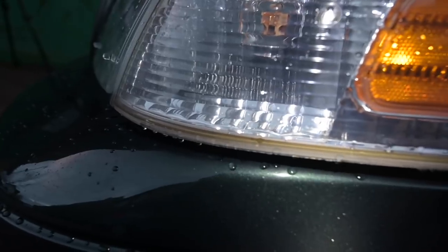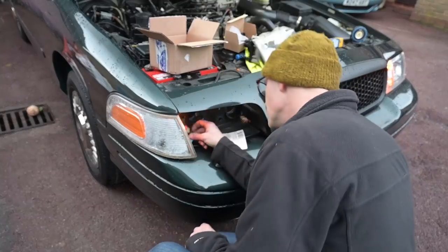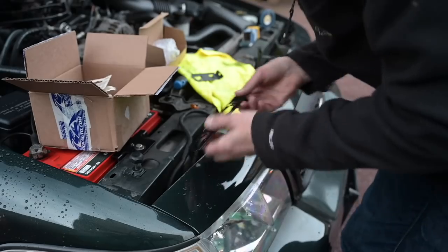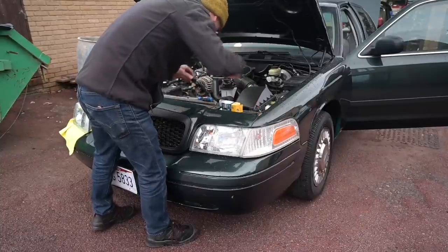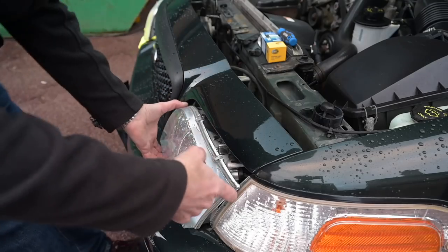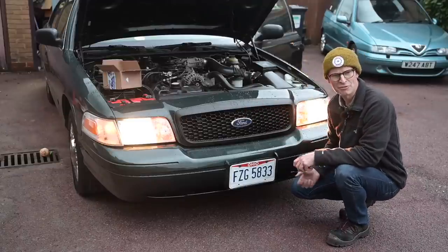The other side doesn't have that extra light socket in the bottom - curious. I'll pop this back in and use my lovely shiny new lamp retainer bracket. I'm going to use both new ones since I don't know how old these bulbs are, and it's always better to change them in pairs. I'll quickly pop out the other one, change it as well, and keep the old one as a spare in the glove box. Now I've got a full complement of working lights at the front of the car.